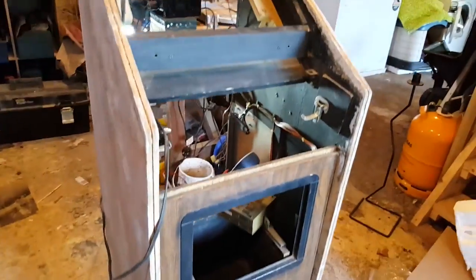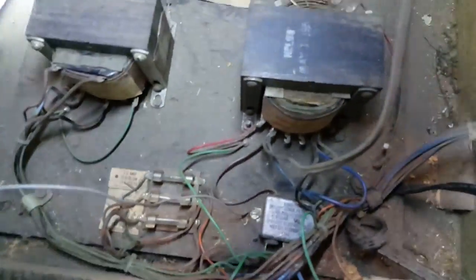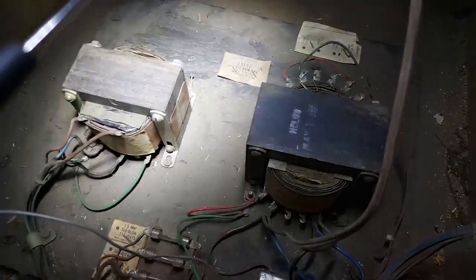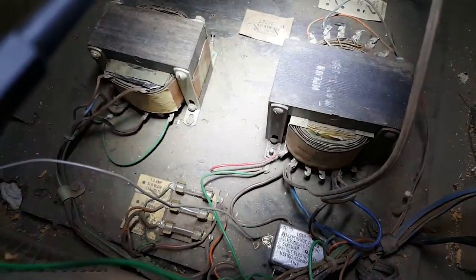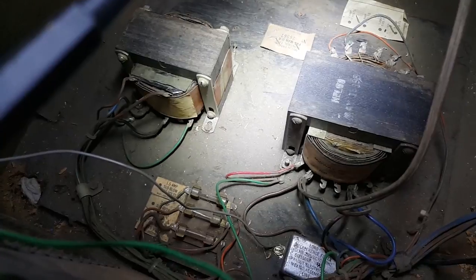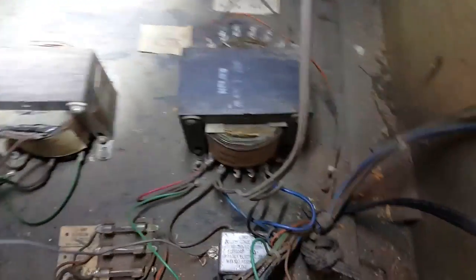It's time to test the harness and the inside. I've tidied and cleaned up a bit and gotten things ready. I've already tested those fuses — they're actually fine. Now this is all rigged up for American voltage, so I'm going to have to use a transformer to convert 220 into 110 or 115. Everything seems to be okay — I'm not seeing any loose connections or anything broken.